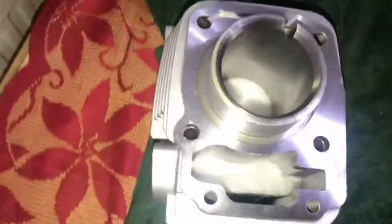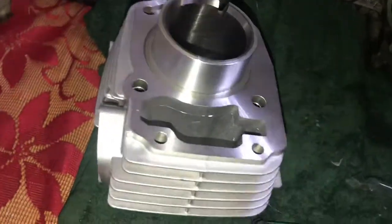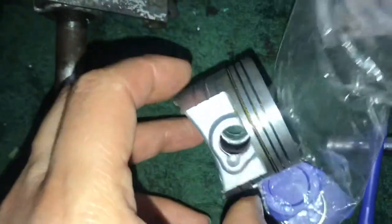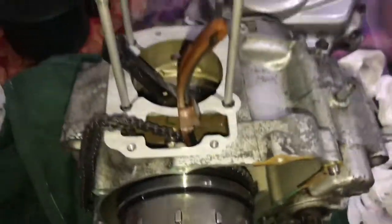What we have here is a nice new cylinder block, cylinder head, and a nice new piston. I'm just in the process of fitting the oil ring in there, along with some new piston rings. There are little pins which go on the end, a nice new gudgeon pin, and a new gasket which has gone on the end — with another gasket still to go on. So I'm just in the process of putting this new cylinder in.